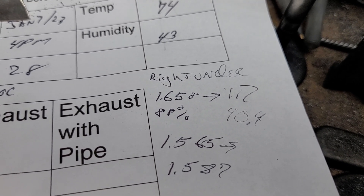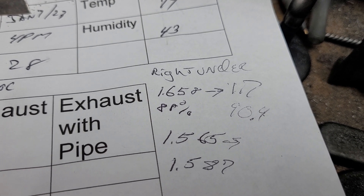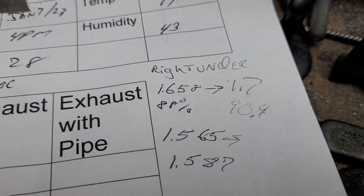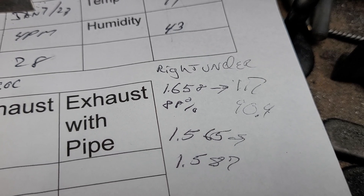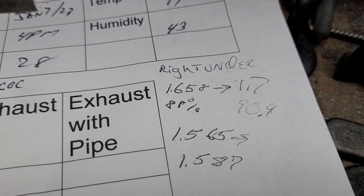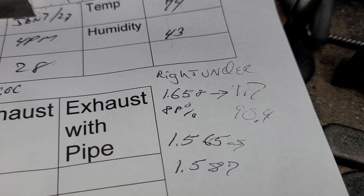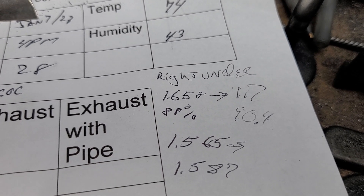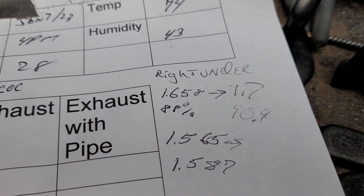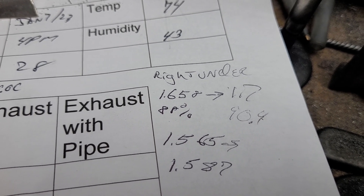Further down the port, the original was 1.565 and it's moved up only 30 thousandths to 1.587. I'm trying to keep these thick - I don't want to make them eggshells. So if you get your throat from those numbers, they're obviously quite tight, quite a bit tighter.